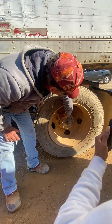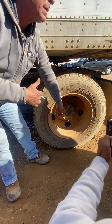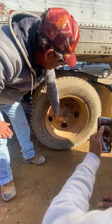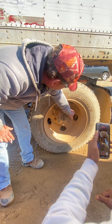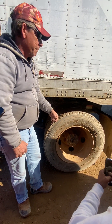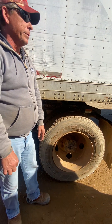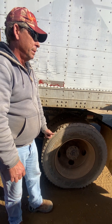Still talking about my wheels. This is an axle seal as opposed to a hub seal — make sure it's not bent, broken, or damaged, and it's not leaking. It is bolted, so I'm going to check my bolts and my lug nuts. Make sure they're all there, they appear to be properly tight, and there's no shiny threads or rust trails that would indicate they're coming loose.